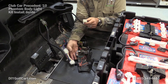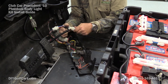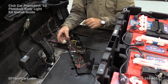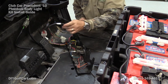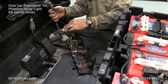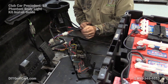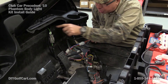Now this will actually plug in over here on the other side where the voltage reducer is. This is the extra one in case this car was actually gas, which would have to have a completely different harness, and which leaves us an extra gray wire that will plug in over here coming out of the main harness. Well, we've got everything connected. Now all we've got to do is shove all this wiring into this little space.